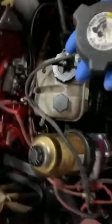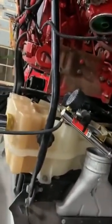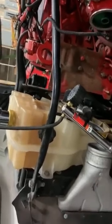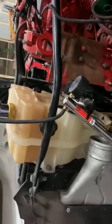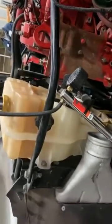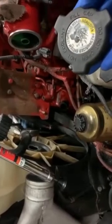The big takeaway is to always look at your caps for the pressure rating. If you don't see it immediately on the cap, check to see if there's a secondary cap, or look it up. A general rule of thumb on bigger trucks is you can always go about eight pounds and be safe, but I wouldn't necessarily use that because it may not be enough to make the system leak, depending on the size and location of the leak. Please remember to always put your caps back on as soon as you're done to keep the integrity of the cooling system and prevent contaminants from getting inside.